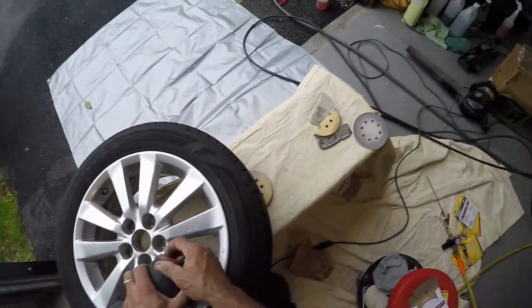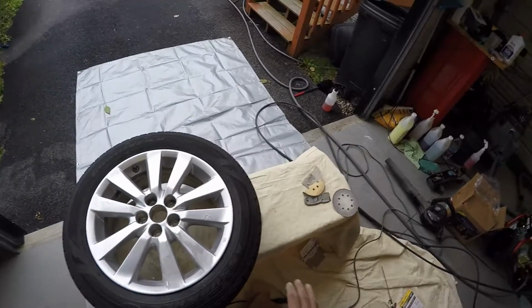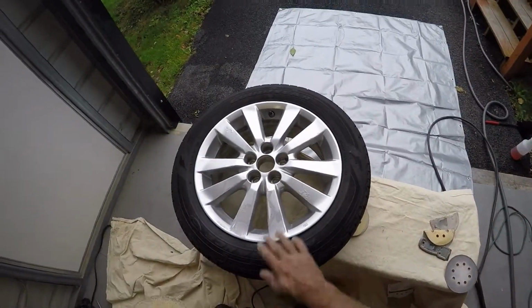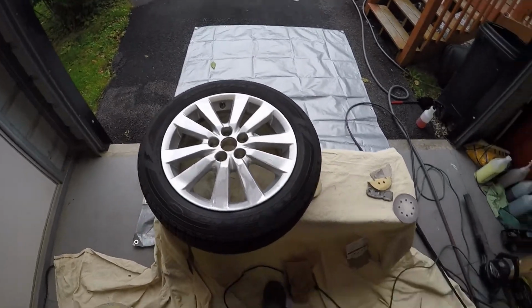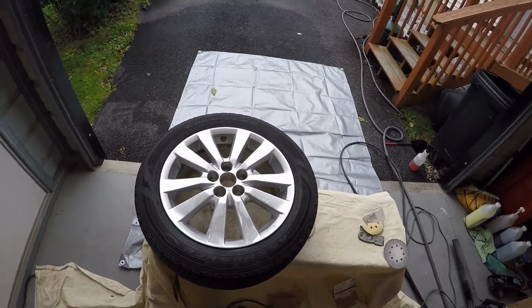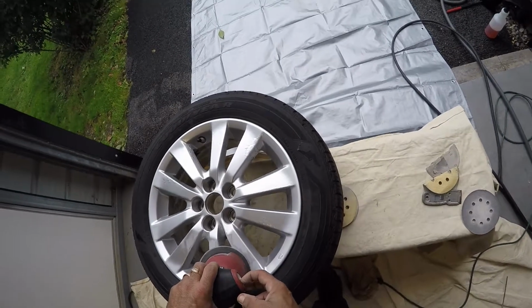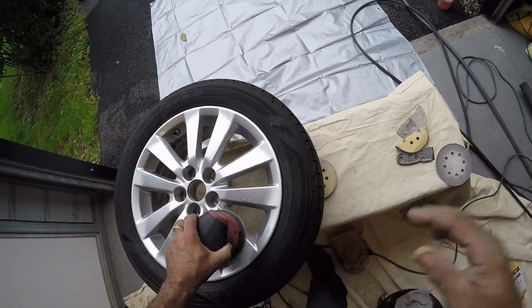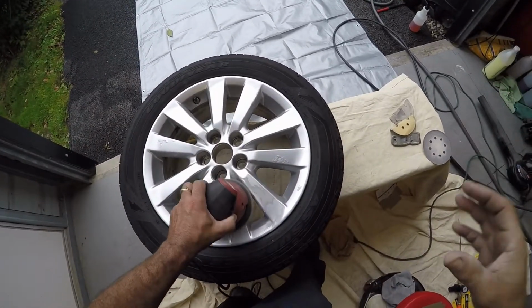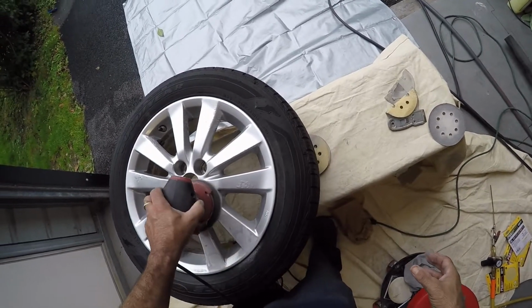Okay, so after I'm done with 100, then I'm going to hit it with some 120 grit, and then I'm going to hit it with some 220 grit, and then that'll be it. That'll all be done, and then I'll do both sides in and out, and I'll clean it all off. So I'll be back on that process to show you guys cleaning it all off. So I'm going to continue sanding. I'll see you guys soon. We'll be right back.